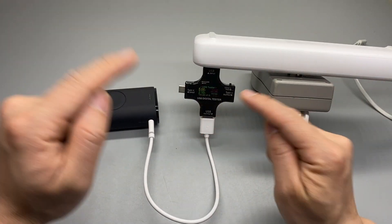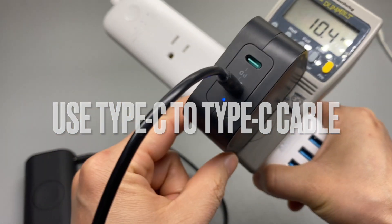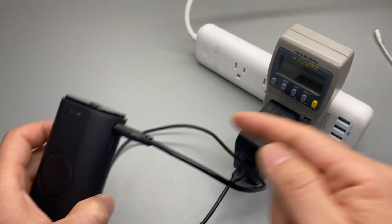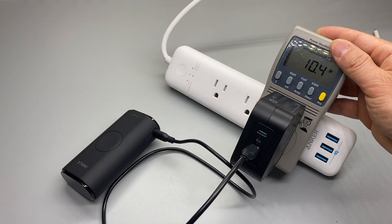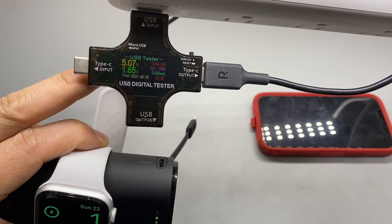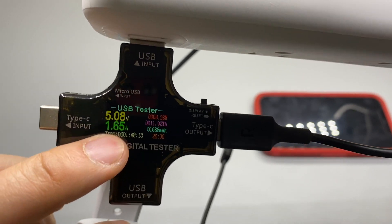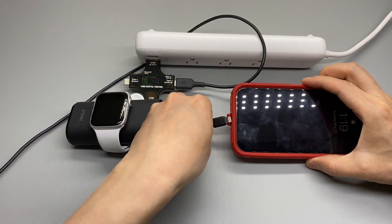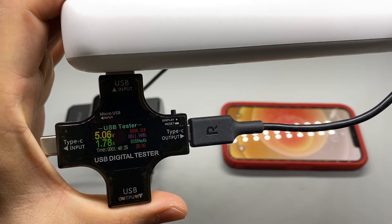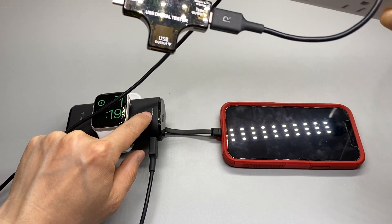In terms of charging, get a higher quality USB Type-C cable. It is worth mentioning that this power bank can be charged using a power delivery port designed to charge your MacBook Pro, so you don't have to carry additional wires — just use a Type-C to Type-C cable, getting about 10 watts. It supports pass-through charging, which means it can charge your device while it is being recharged itself. It's almost full, getting around 8 watts. We can use it to charge an iPhone and the wattage increases to 10 watts. Keep in mind this battery bank is almost fully charged.